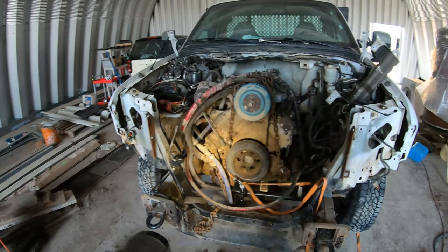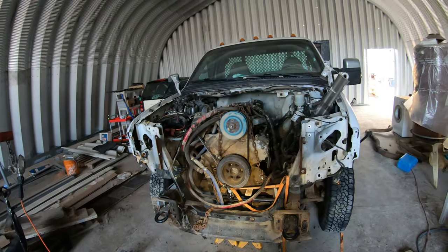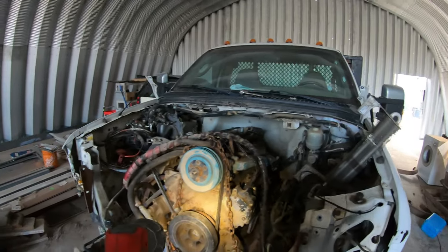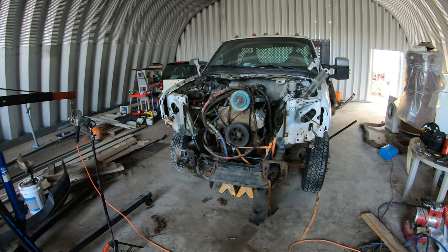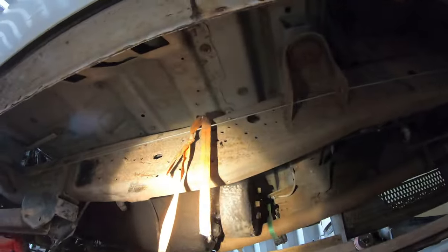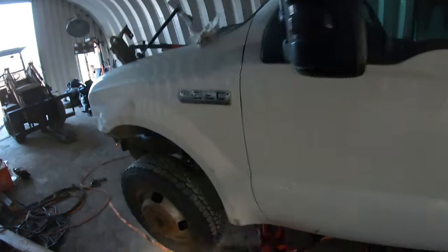Just trying to wedge it in there. If I do it again, I'd probably do it the same way because I didn't want to take the oil pan off, but it fit — you just got to kind of shoehorn it in there. You leave the oil pan on with a three-inch body lift. If I need to lift the engine, I just use the engine hoist and lift the back of the transmission up and down to where it's got to sit. When I get everything situated and sitting where it's going to be, then I can start putting the mounts in.